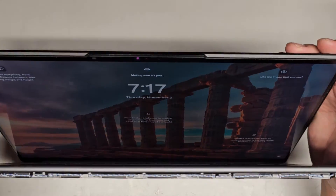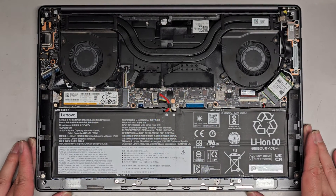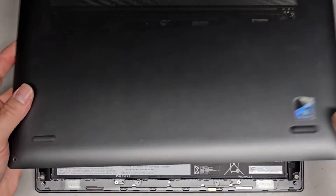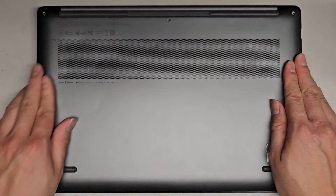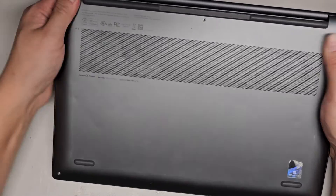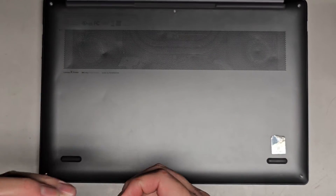We just got to put the bottom cover back on and that should be it. Let's get this lined up and centered. Make sure everything is reconnected and nothing is left out. You want to put the bottom in first because it has those little hooks there — go at an angle, kind of line it up, make sure to hook it all in, lower it down, and then you can clip this stuff in. Push in as you push down to get those clips to go. Let's get the T5 Torx 5 screws back in and then we should be good. That's pretty much all there is to it.